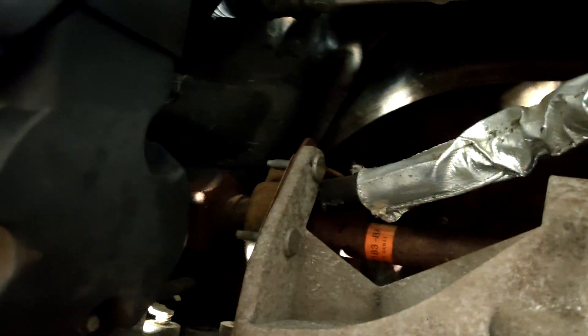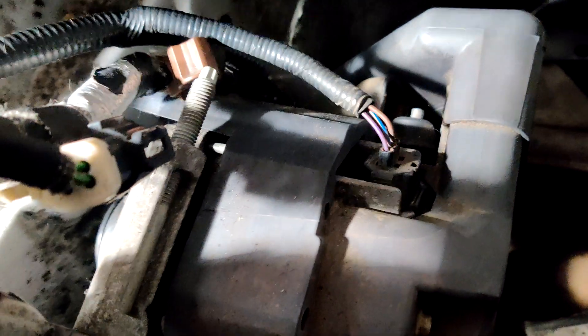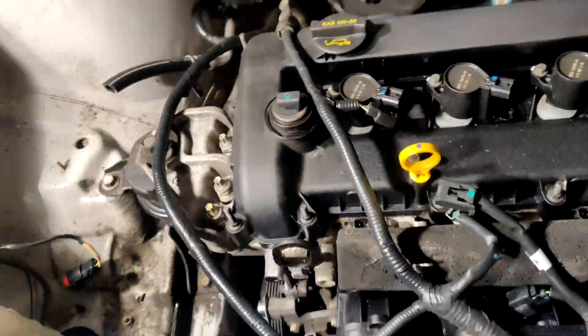So the one thing I've been working on is down here. You can see the half shaft heading from the transmission right to the wheels - this is the front passenger wheel. There's a support bracket right here connected to the engine block, so I need to get that out. It's kind of hard to get to, so I decided I should take the alternator out since I'm not sure there will be clearance for it anyway.